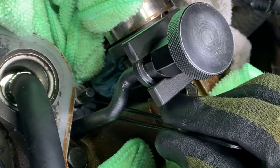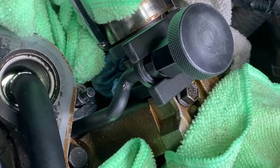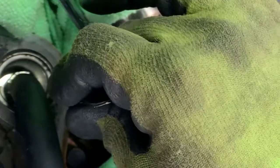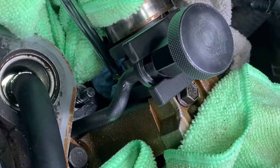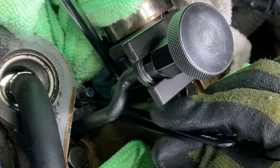Now I add the keepers, easing them in there. You should have enough of the grooves on the edge to hold the keeper on there. If it doesn't seem to be sticking on there, it could be that your valve stem isn't all the way up. I experienced a valve stem that was stuck and corroded down and I had to put some force — I found that it was lower than the other valve stem. But once your valve spring is compressed enough and your stem is all the way up, you can easily get these keepers on there without issue.